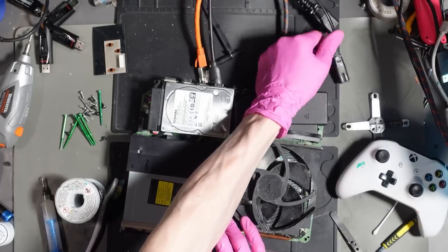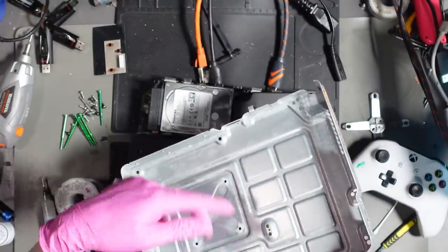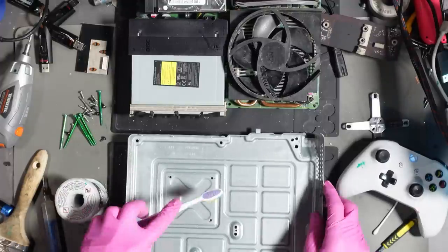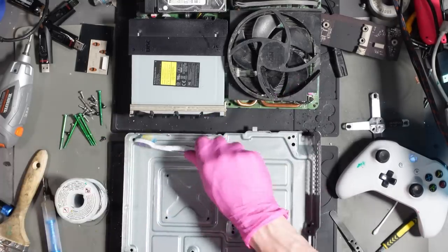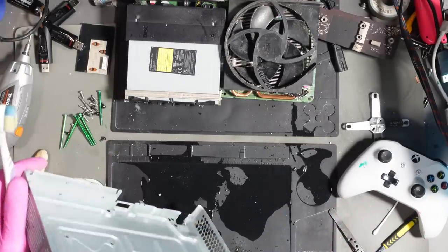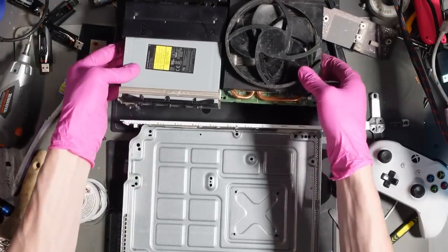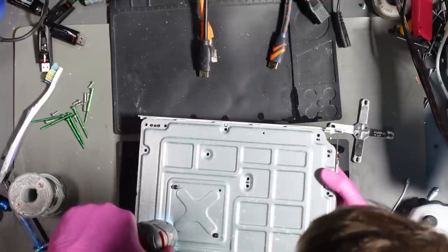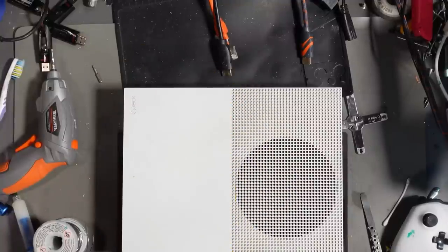So I'm going to get it back together. I'll clean out the dust and try to scrub some of this — I don't think I'm going to get it totally clean. I'll give it a little bit of a scrub using IPA to neutralise that milk. The isopropyl alcohol will evaporate itself and it's non-conductive as well. And voila, she's done.